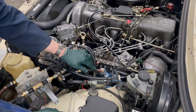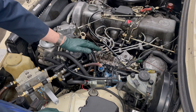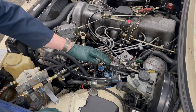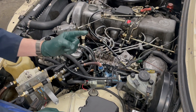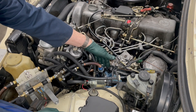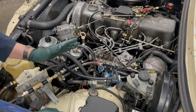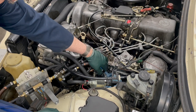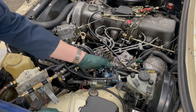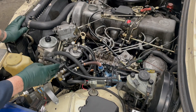What I want to do now is pull off the hose going into the injection pump. Then I'm going to run my two electric pumps — I have an electric pump here for diesel fuel and one in the trunk for vegetable oil. I'll pull this line out, start turning valves, and make sure that when I turn the valve to vegetable oil I have vegetable oil going to the injection pump, and when I turn the valve to diesel I've got diesel going to the injection pump. That'll confirm my plumbing and valving are correct.